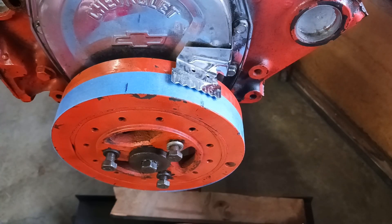It's very important to do this. If your timing is off, you could have serious detonation problems if it's way too much advanced, or you could be losing a lot of horsepower and torque if it's too much retarded. On an eight-inch balancer, two inches is approximately 30 degrees. So if you're off only a half of an inch, that would be approximately eight degrees out. If you had your timing set at 38 degrees and you were eight degrees out on the high side, that would be 46 — way too much. If it was the other way and set at 38, it would only be 30, and you would be losing a lot of horsepower and torque by not having enough advance in your engine.